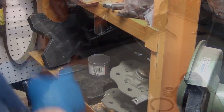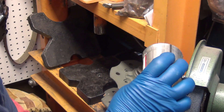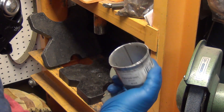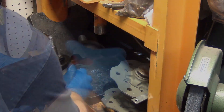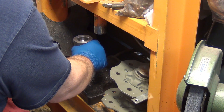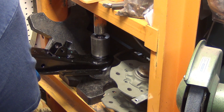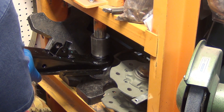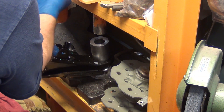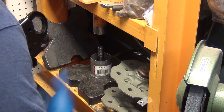I have air over hydraulic here — this is just a two-and-a-half inch tube, and you can see it's getting beat up pretty good. It's two-and-a-half inch ID and it just slips on there. I get it somewhat centered under there, and I haven't had too many pop that hard, but out it comes.